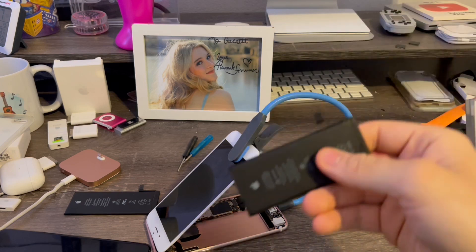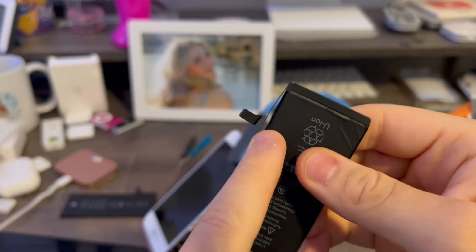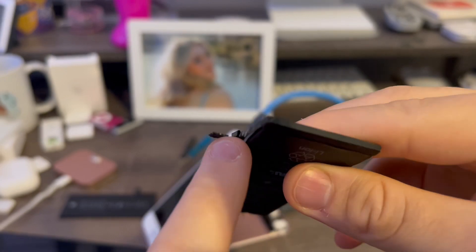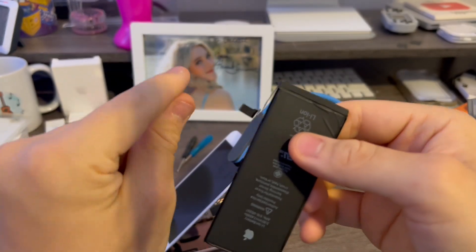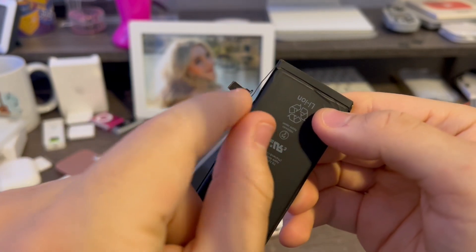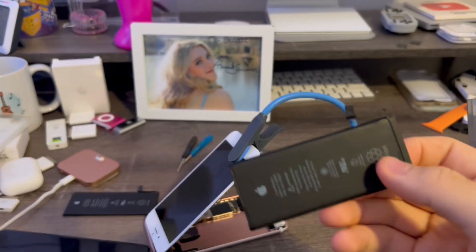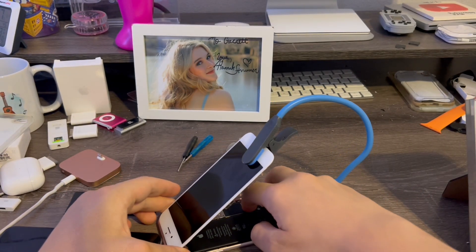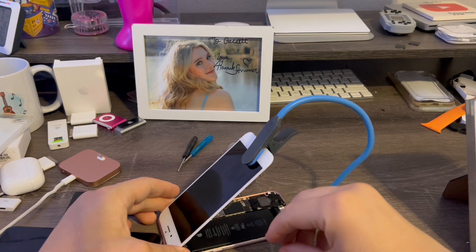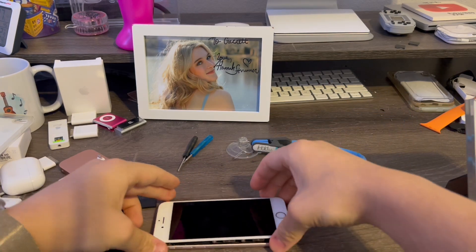Okay, so now get your iPhone 7 battery. You'll have to make some mods to this before it works. First, you'll have to reshape the cable like this in order to get it to fit. If you don't do that, the cable won't reach the connector. On the first fold, make sure you do it right there between the tape line between the connector and the ribbon — if you do it too tight, it will rip. On the second fold, make sure you don't crease it with your nail; just pinch it with your fingernails but don't crease it. You have to line it up right here with this symbol for it to work. It should look like this after you do the folds. It'll be tricky the first time since the connector won't pop right away. Once you have the cable folded just enough so it won't stick out and push the connector out, you can pry it right down just like that. Now I'm going to release the iHold Evo and put the screen back down.